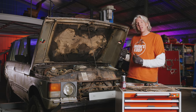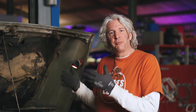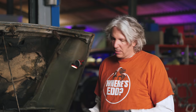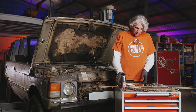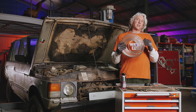The plan is to try and get it to an MOT station and then maybe through an MOT test. For that to happen, I need to be able to drive it out of the workshop. We've established that the fuel lines are totally shot and unavailable, so I needed to make my own. I've opted for cunifer, which is a nickel copper alloy — much more flexible than steel and it's not going to corrode nearly as quickly, so it'll probably outlive the Range Rover itself.